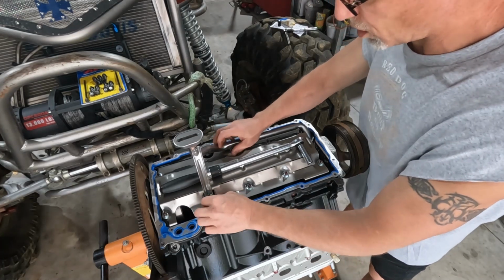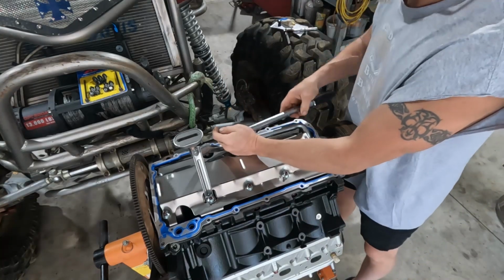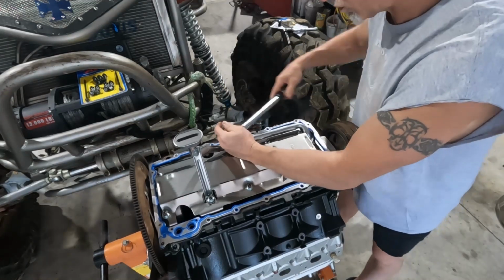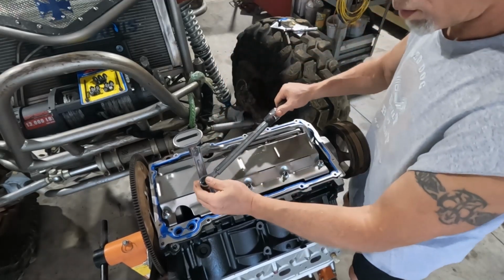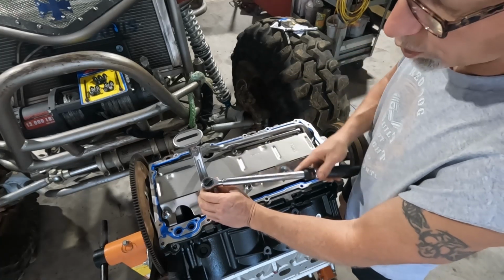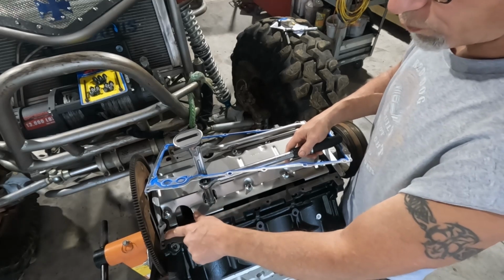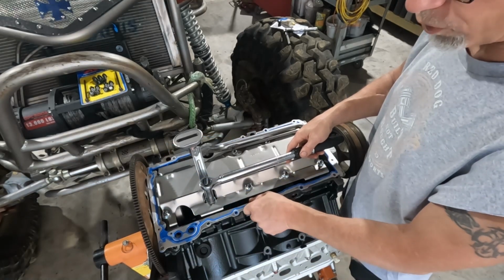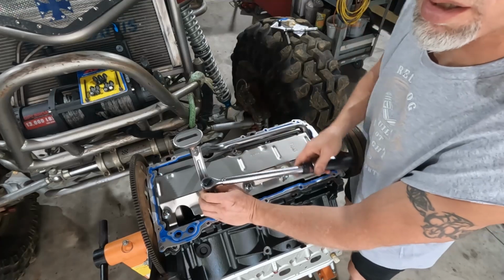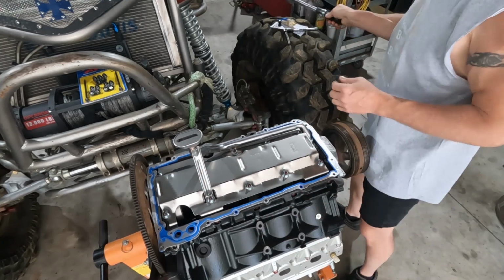We'll put the last 2 bolts on. Crank them down. And the last one. Now what we're gonna do, I gotta go get some RTV. We'll put that in the 4 corners of where the block meets the front and back cover. We need to seal those up with RTV before we put the gasket on it. Then we can set the cover in place. Need to break open. We got an ARP bolt set for this. Rather nice. All right, there we go, locked in.